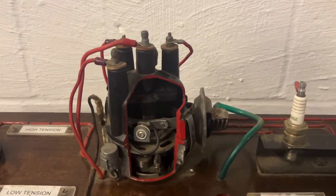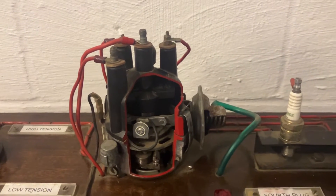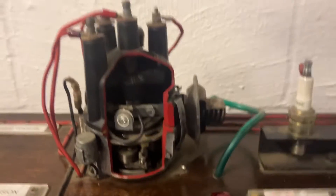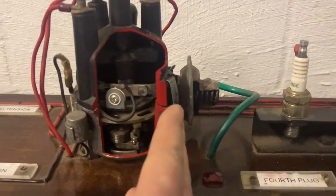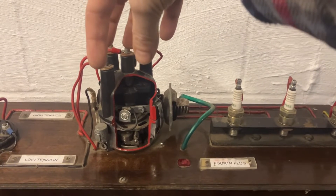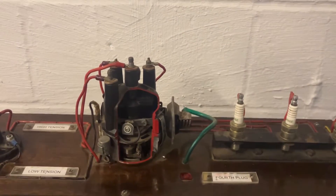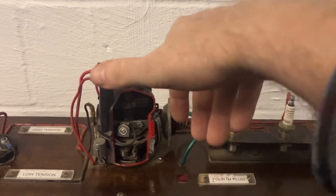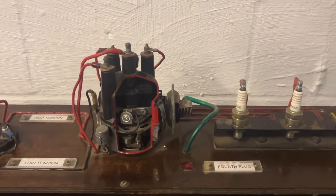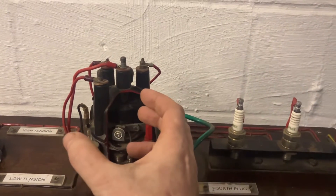But it's not quite ideal, because if you're at low speed and you press the accelerator hard there may be a delay until the RPM builds up. So there are a couple of things which help with that. Down here we've got some spring-loaded weights which use centrifugal force — spinning force — so as the engine speeds up those weights come out and that actually spins the cam, making the distributor fire slightly earlier. The faster the engine is going, the faster the pistons are going, so as a piston's coming up the cylinder faster and faster the spark needs to go off earlier and earlier to hit it square in the face when the piston's at top dead centre. If there was no advance — distributor advance — then the spark will be too late to meet the piston and the piston would already be travelling back down as the spark plug fires.